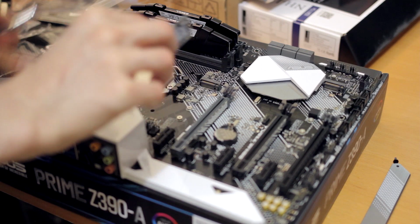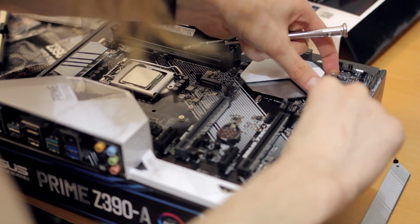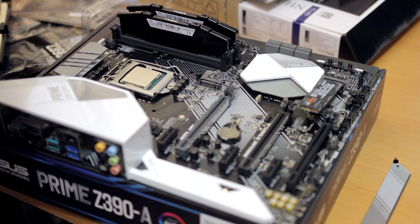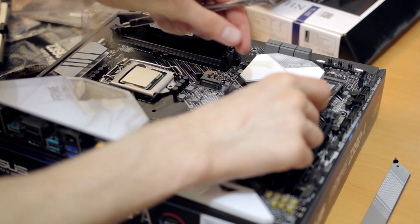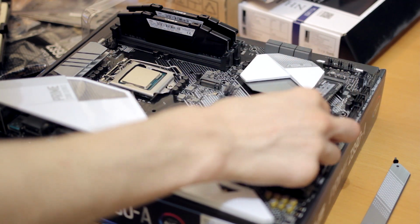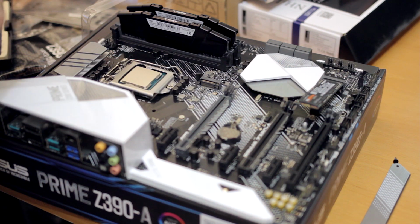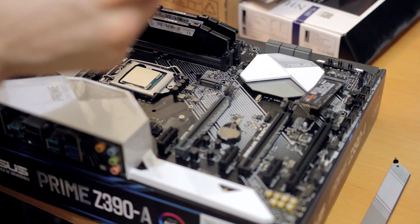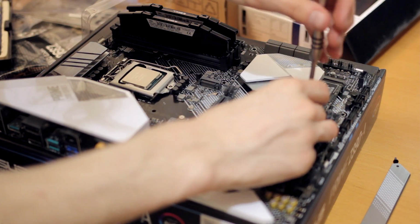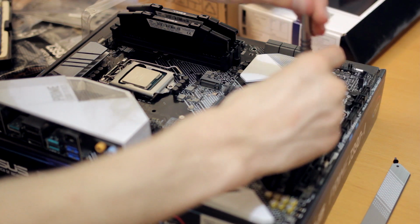There's debate on should you actually use the heatsinks or not, because sometimes you're like, yeah, but the DRAM doesn't want to run that hot, and it's like, nah. Realistically, it really won't matter. This system doesn't even need much I/O, and when you're booting Windows and loading documents, you're not using it much, so you're never going to get into thermal throttling even without a heatsink, but it's probably not bad practice.